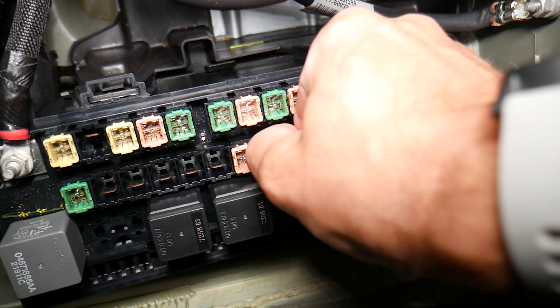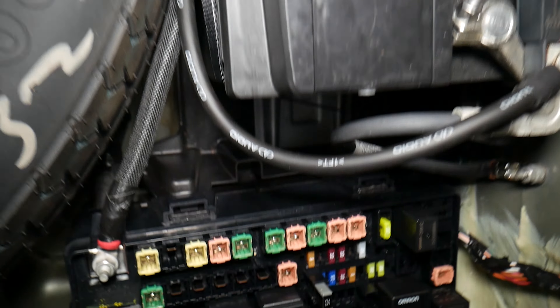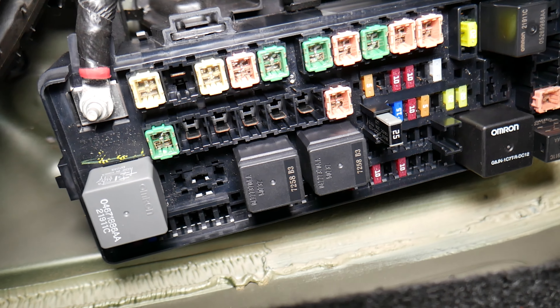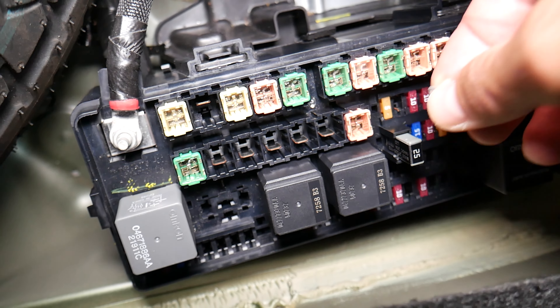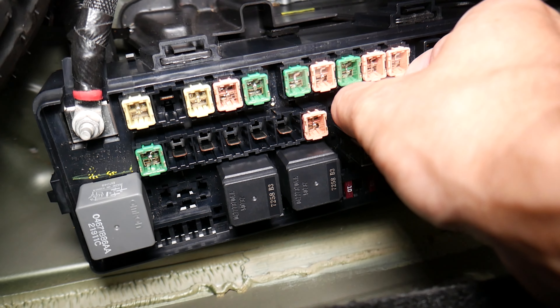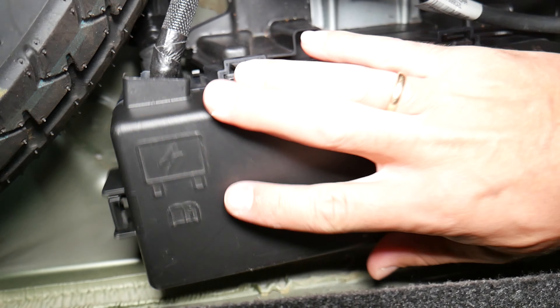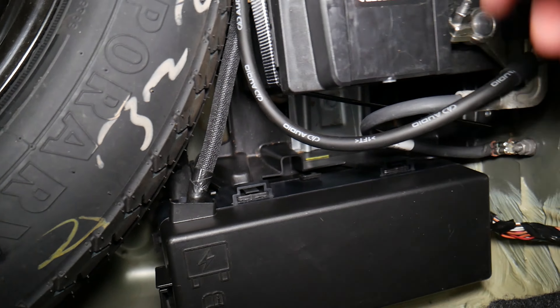You go ahead, grab it with the puller, pull it out, and remove it. You can see this is the fuse. I'll grab the new one and go ahead and install it now. Pretty simple. If your diagnostic port still does not work, we have a special video that explains why the OBD diagnostic port does not work. Hopefully this video was helpful — thank you for watching and see you next time.